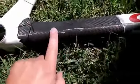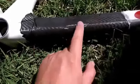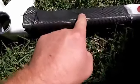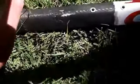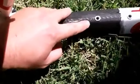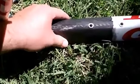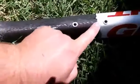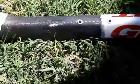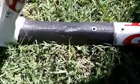I also exposed enough of this area where I can make a good solid repair. You want to go at least two inches from the furthest point of your crack. On this crack here, it goes to about right here, and then on the top the crack goes to about right here. I realize there might be a little more cracking underneath that I can't see, but I'm going to wrap it clear up into here just in case. The more you go, the more solid it's going to be.